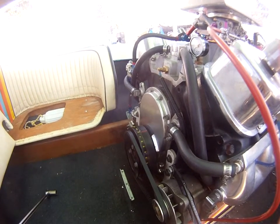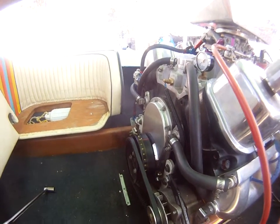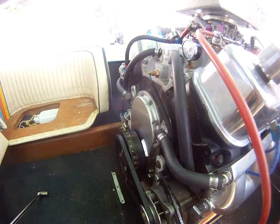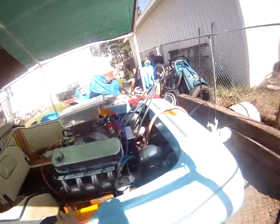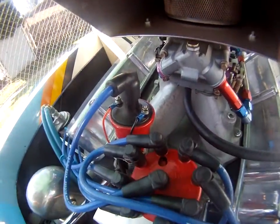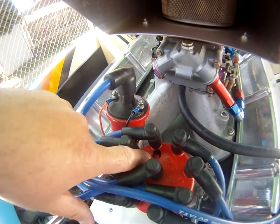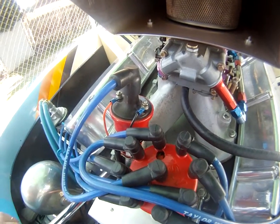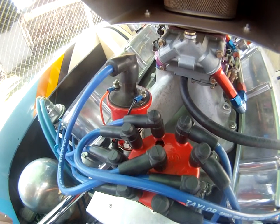I've done the 30-degree timing thing, set everything on the cap and rotor, and now I've brought it back to 36 degrees of timing. I want to see at 36 where it's sitting without using the timing light method or anything else. You'll see that the rotor is sitting just to the left of the number one cylinder, and that's where it should be sitting — at the left angle — because once the rotor advances with the mechanical advance, it's going to move to the left.